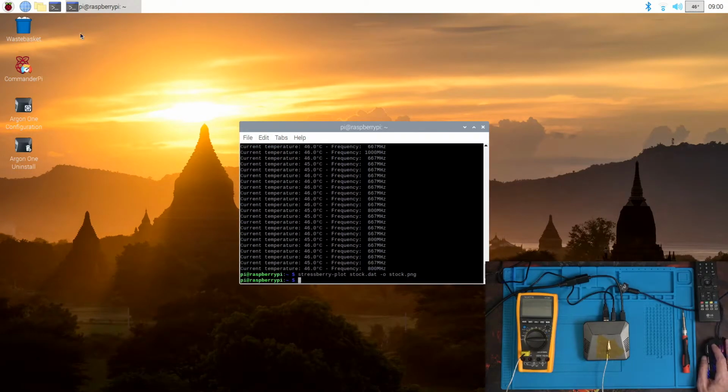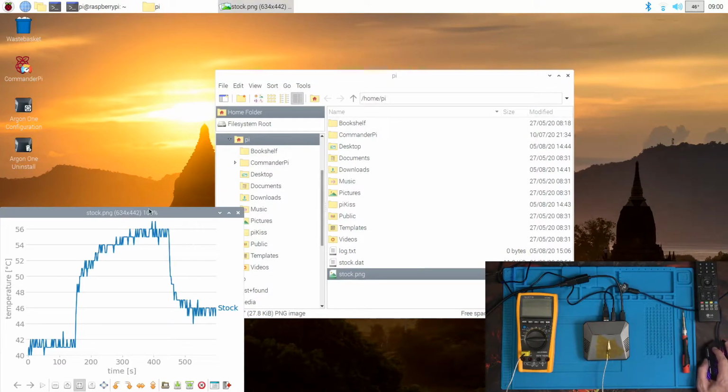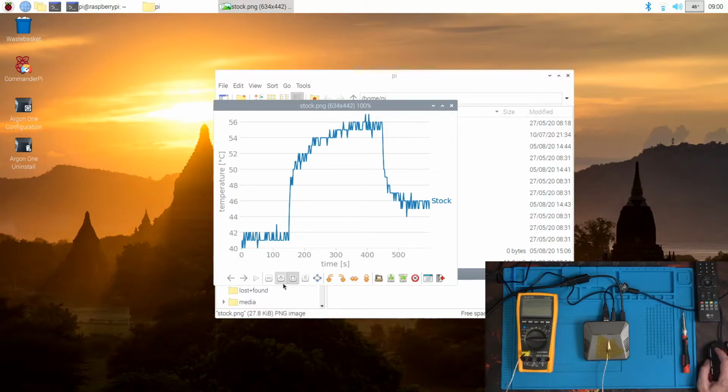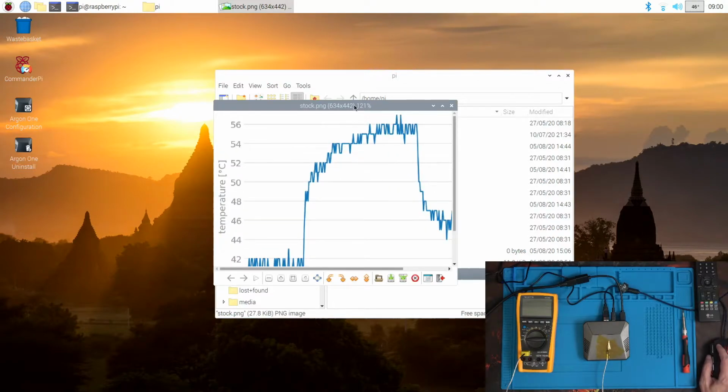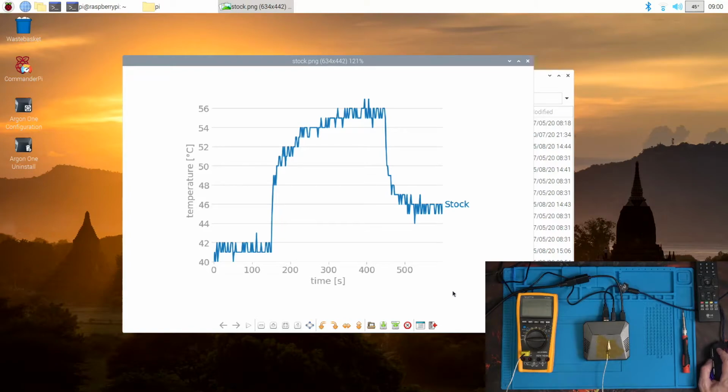Okay, let's have a look at the output from all of that. Let's have a look now. Zoom in a little bit. Now we can see that obviously it was idling, even peaked at 43 degrees Celsius at one point when it was idling, but then it shoots up when it's actually been told to start doing stuff at 2 gigahertz. Not slowly, actually quite quickly, it jumps up to roughly 55 degrees Celsius,